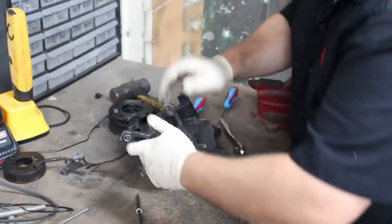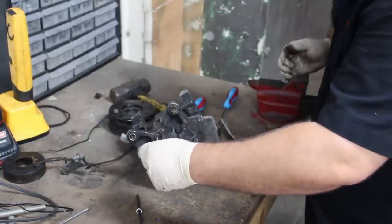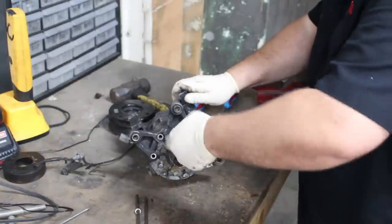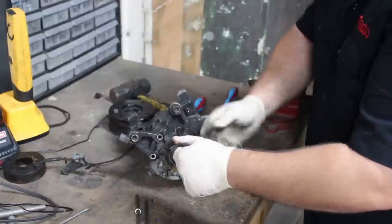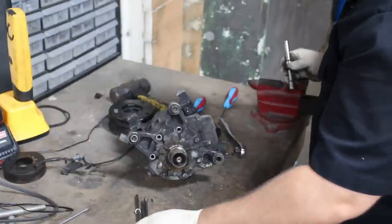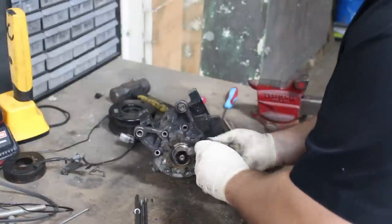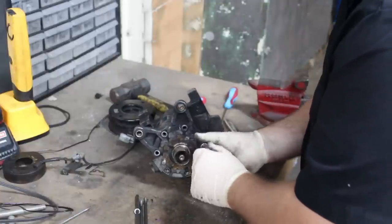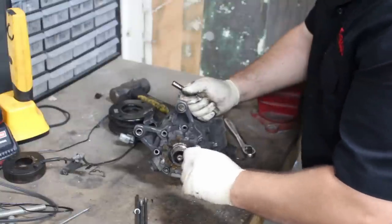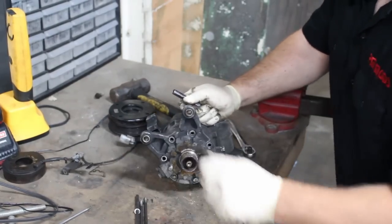That smells like coolant, or refrigerant. And if you're wondering why I have an air conditioning compressor, when I bought the Lexus, it did not have air conditioning. The compressor was bad, or I should say the clutch was. And for stuff like air conditioning, I don't believe in just replacing one part. There's no way I was going to risk it and just do the clutch. I did the whole compressor and then the receiver dryer with it. I just don't feel like opening the system more than once, because it was a pain to do this compressor. So if I'm going to take it out, I'm just going to put in a new one. Save more headache down the road. It's a 15-year-old compressor anyway, so why not replace it?